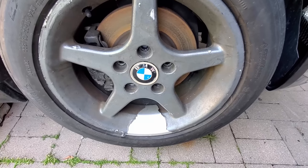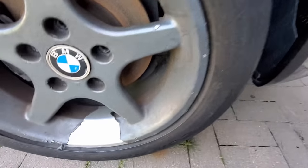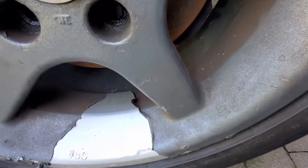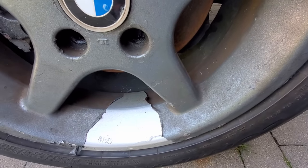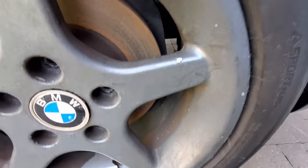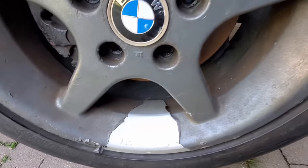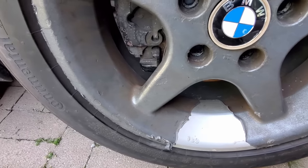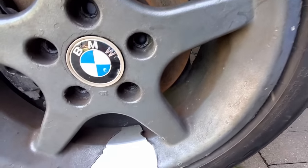The other reason is that not enough coats have been applied to build up enough layering that you can pull it off without ripping it. When I paint them, I usually do a minimum of six coats — seven or eight coats is usually best. Another thing I noticed was as I was peeling it off, you can see large gouges in the wheel showing through the PlastiDip. So someone not only didn't do the job properly, they didn't prep the wheel properly.